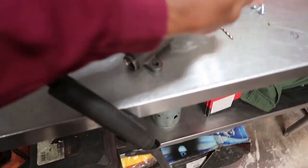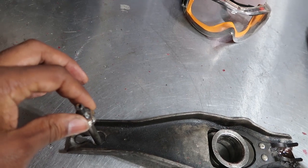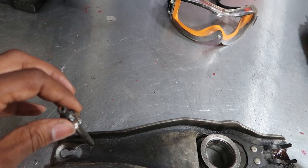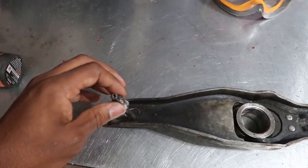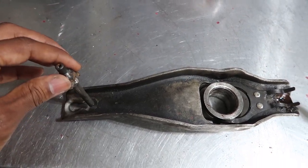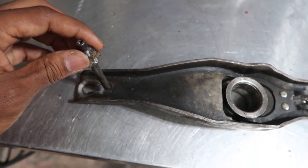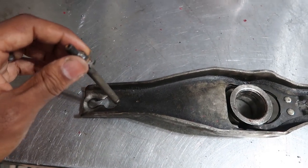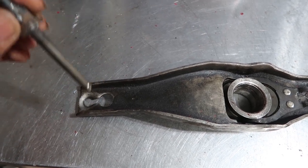But originally, I had my push rod lined up to this hole, and this is the hole that I was using on the T5. And on the T5, it worked, but it just barely worked passingly. When I had this here on the TKO, I don't really know what the big difference was, but it worked just well enough for me to get the car moving and change gears, but I was gonna tear something up if I was gonna keep using it in this hole because it just wasn't pushing it far enough. I mean, it could have been 3 millimeters off that would have gotten me there, but it just wasn't quite getting me there. And as you'll see, the gears and stuff are grinding.